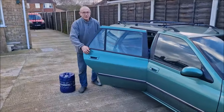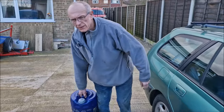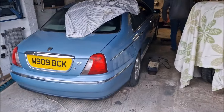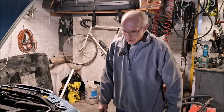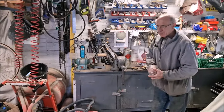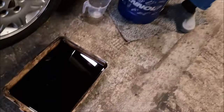Hello, good morning — how are you doing? Now we can hear you chuntering away. How are you? Good, thank you. Enjoying your Saturday? Yes, thank you. What are you doing? Changing the oil and filter, mate. You've stolen my thunder a little bit — I was going to do a video on how quickly you can change the oil and filter on a Rover 75. But you've started without me. So you've drained the oil out, taken the sump plug out. You've put in a new Blueprint filter — three or four quid. And I've bought some Manol 10W40 oil — 20 litres for about £30. Four and a half litres is what this engine takes.